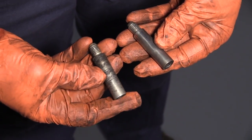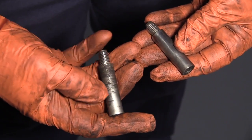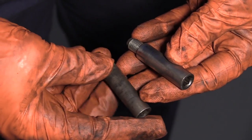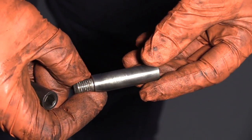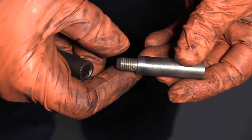Here's the slider for the caliper — this is what it looks like prior to cleaning, just all filled up with gunk. That will not slide nicely through that caliper bushing. I took a wire wheel brush to it and cleaned up all that gunk, and we'll apply some brand new caliper grease so it slides properly.